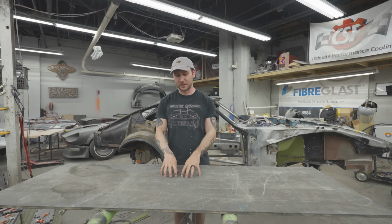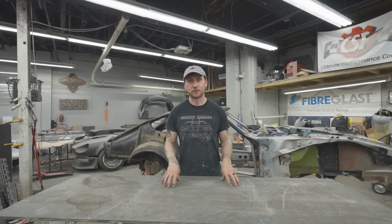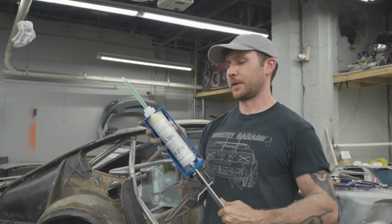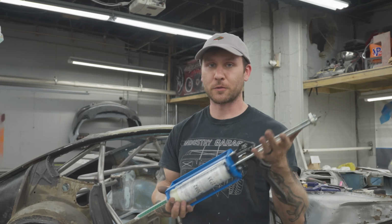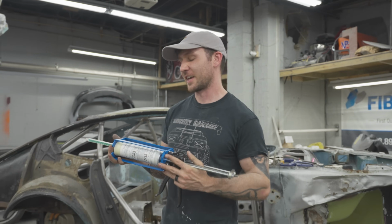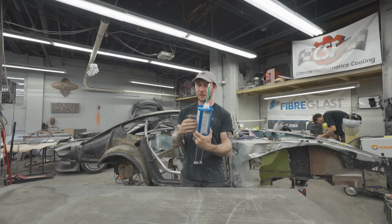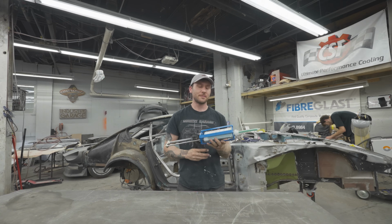This is the side that the peel ply was on, so this is a really good keyed surface to bond things to. So we're going to try out this EpiCoat MGS VPR20. This is another glue comparable to DP420, but it's not like $100 and some per small container. Yeah, when you told me how much that stuff costs... I think a 10 pack of DP420 is $1,600. The large ones are smaller than this container. I don't know how many milliliters it is, however they judge us. Yeah, I'm not trying to do that.